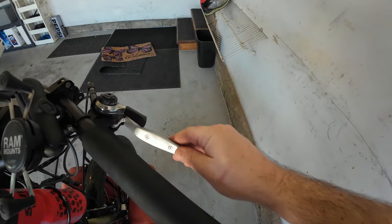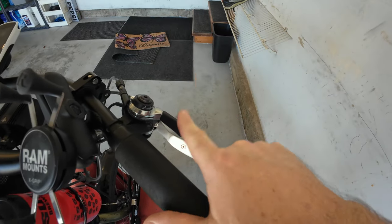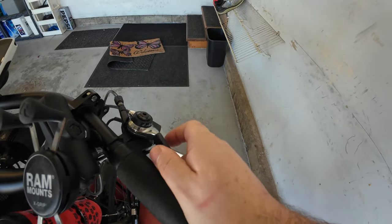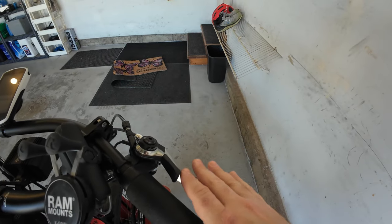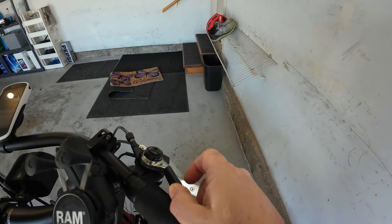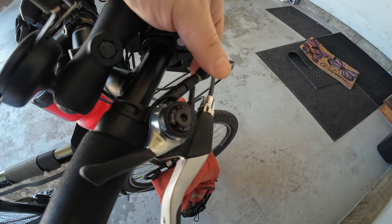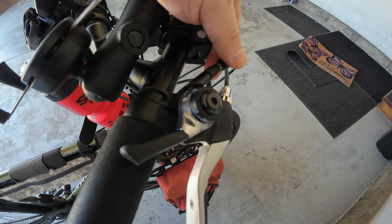Moving to the other side, I've got standard e-bike brakes with a kill-switch wire. I also have a thumb friction shifter — this thing is absolutely wonderful. It's indexable up to 10 speed and way easier than a traditional setup. Since there's no front derailleur, just the rear, this is one of my favorite upgrades. I also always put inline cable adjusters so that on tour I can fine-tune shifting on the fly if the cable stretches.